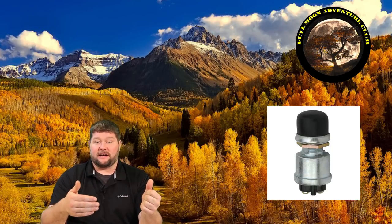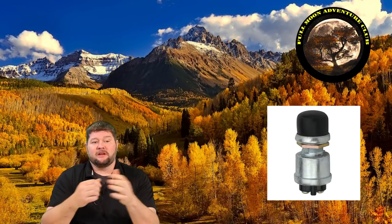You hold it down — I've had to hold it down for five or ten minutes sometimes to actually get enough power into my chassis battery to start the engine. So I'm going to talk about a few tips and tricks and things you might not know about the emergency start switch if you're new to it, and share my experience with it.